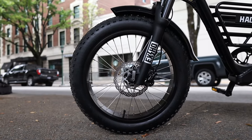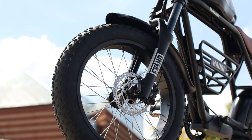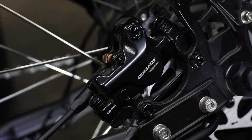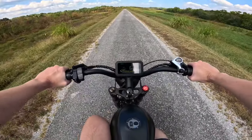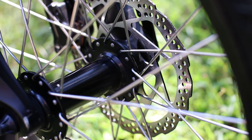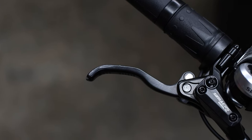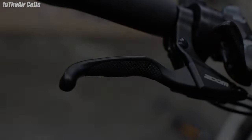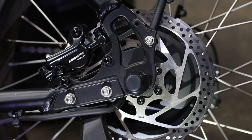Wheels and tires aren't really that important if you can't stop them, and that brings us to the brakes, which are a big thing for me — I've always jumped through hoops to upgrade brakes on my bikes in the past. But that isn't needed here, as these are leaps and bounds better than the brakes on the bicycles I've tested, thanks to them being hydraulic and not mechanical, sporting 160 millimeter brake rotors on both ends. Hands down, it has some of the best levers I've felt so far — the overall braking system is one of the standout highlights, next to the overall handling.